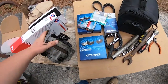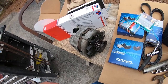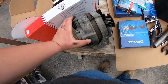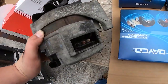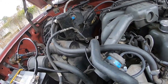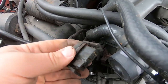I wrestled this thing out of here and I'm wondering if the alternator was the problem. I hear that if you spin them and they just keep on spinning, that means the brushes aren't catching it at all and it's not doing well. We also had some corrosion on one of these connectors, which I doubt was helping it. That's the male end of it. I kind of broke some of this plastic trying to get this thing off - it was on there good. This thing just looks like a mess.